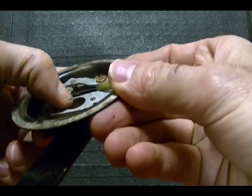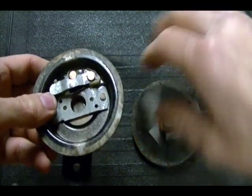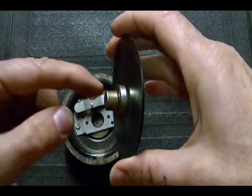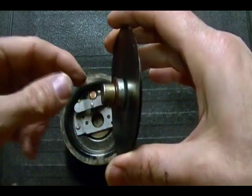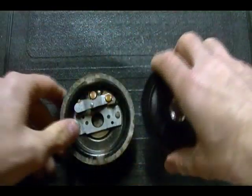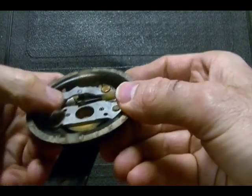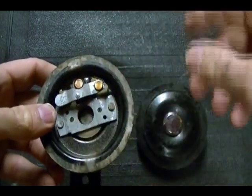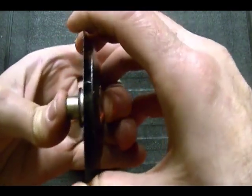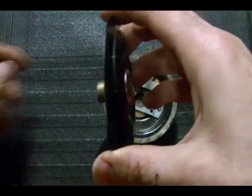When they open up it breaks the circuit. The electromagnetic field collapses so you no longer have any magnetic force, and when that happens the spring steel in this diaphragm causes the center of the diaphragm to move out. When that moves out, it moves away from these contact points. The contact points are able to close again and the whole process just keeps repeating, causing this spring steel diaphragm to move in and out very fast at a very high frequency — and that creates your sound.